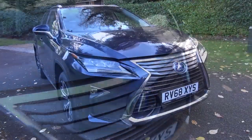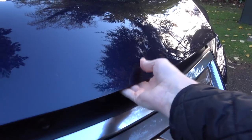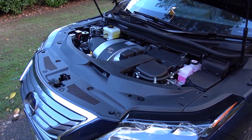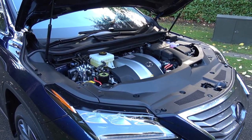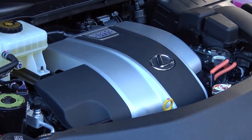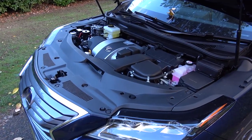Let's move to its powertrain. The bonnet can be unlatched using the catch on the driver's side, and then lifted up after depressing the latch underneath. It is powered by the same hybrid powertrain found in the standard RX 450h — front and rear electric motors providing 165bhp and 67bhp respectively. These are twinned with a front-mounted 3.5-litre V6 that produces 258bhp and 335Nm of torque. The total output is also the same at 305bhp.